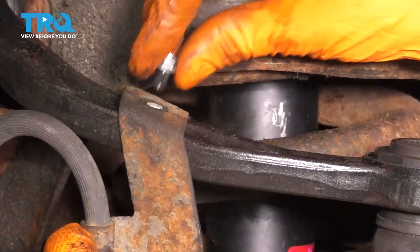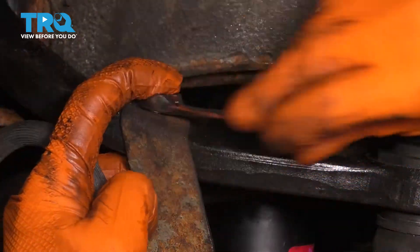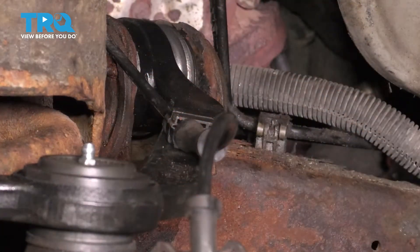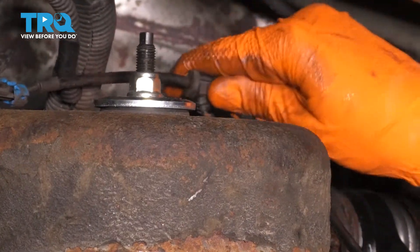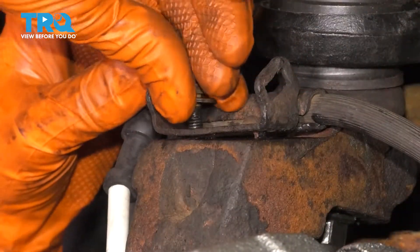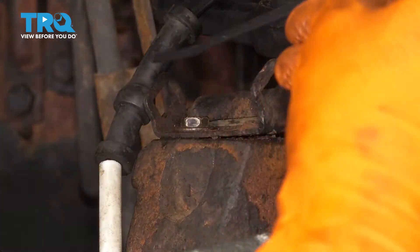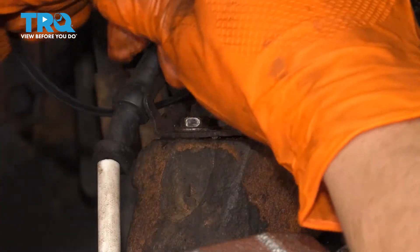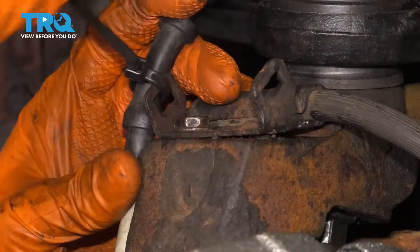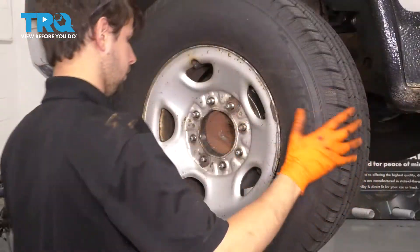Let's remount the bracket for the brake hose — I have a new bolt here and I'll go ahead and snug this down. On the other side let's mount the ABS wire, and also mount it on top of the frame where I took it out. Put this back onto the knuckle and start in the bolt. I'm going to secure this wire with a tie, make sure it's nice and tight, and cut off the excess. Let's get the wheel back on.